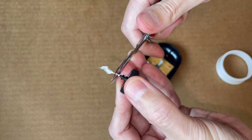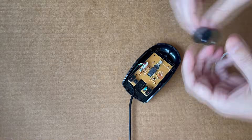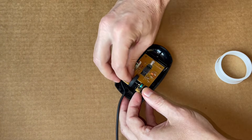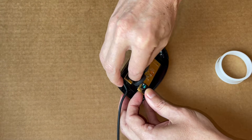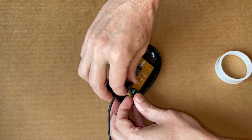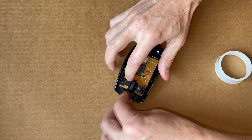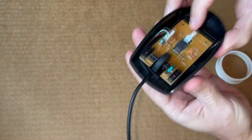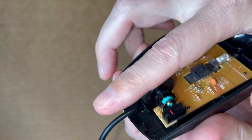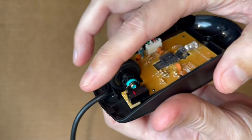This should be good enough, and the excess tape you can cut with scissors. Now insert the mouse wheel inside that green cogwheel, but first you'll need to lift up the circuit board just a little. If you make the tip a little too thick, it may not fit at all, so try again with a little less tape. And now, when I spin the mouse wheel, the green cogwheel rotates as well — and that means it's fixed.